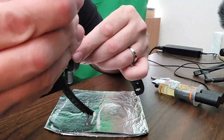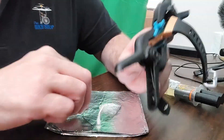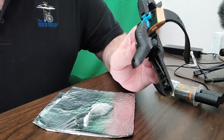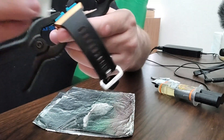After putting the two-part epoxy in place and setting the screen into the bezel, I had to clamp it to hold it tightly while the epoxy cured. I then realized that some epoxy had squeezed out between the bezel and the screen, so I attempted to clean it up with an alcohol wipe.